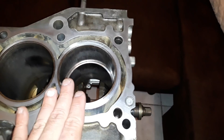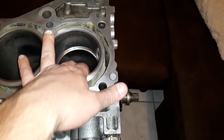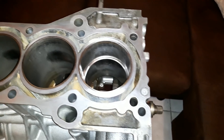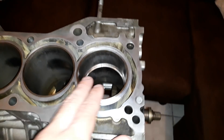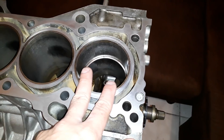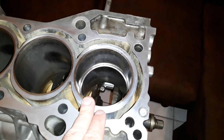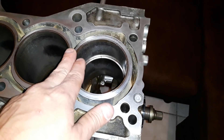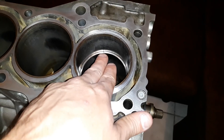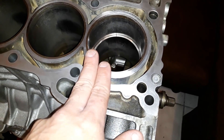More specifically, how I use the ring to check the bore. If you want, you can do three measurements — measure up high, in the middle, and closer to the bottom, staying a bit away from both ends. That's how I use my rings to check. If you have big ring gaps, generally speaking your block is probably done. Now it is possible for the rings themselves to be wrong — we've talked about NPR rings having gap issues. The way to double-check: if your top ring measures healthy but your second ring gap is enormous, you have a ring issue.